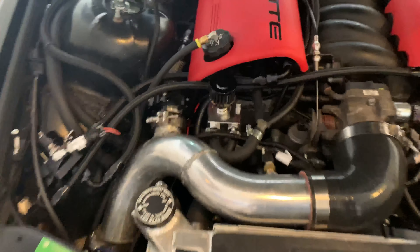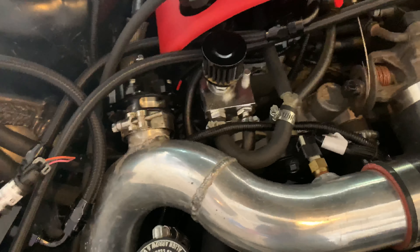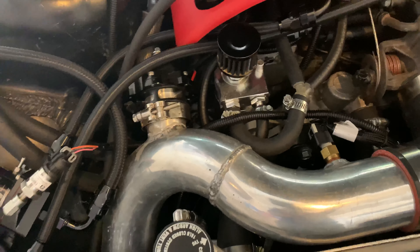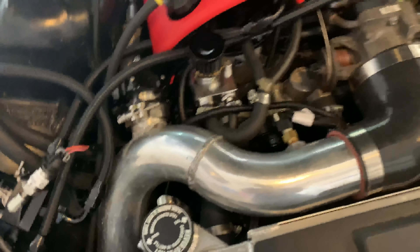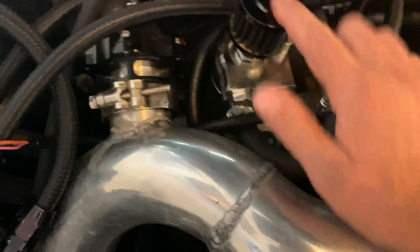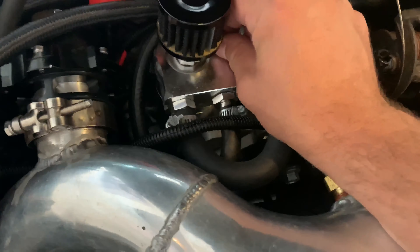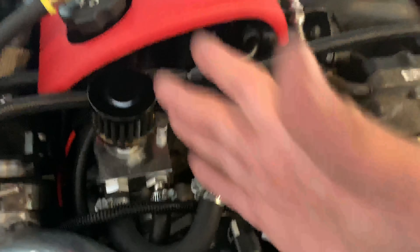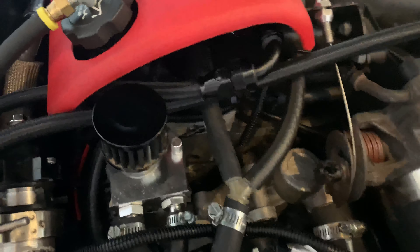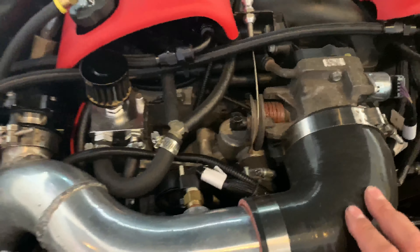The catch can — I did a review video on it for my C5 Corvette. It is just your regular eBay/Amazon catch can; I'll put a link for it in the description below. It was $29 and it really does the job. This one has a breather and a dipstick, but I also have a 1 psi check valve in there, so when boost is building it doesn't push through and blow out all my oil seals inside.